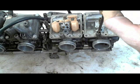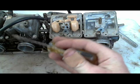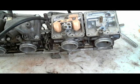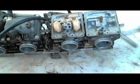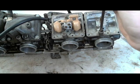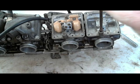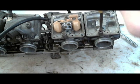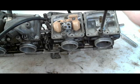So what I always do with these, actually before I unscrew this, I should say this. Considering all of these caps are unscrewed, all these little caps that I was talking about earlier, they regulate the air fuel ratio. Why couldn't I think of that? They regulate the air fuel ratio and make sure that it's at the ideal when it's idling. So before I unscrew these to take them out, I'll gently tighten them down and count the half turns. So that's half, one, half, two, half. So right now it's at 2.5 turns.